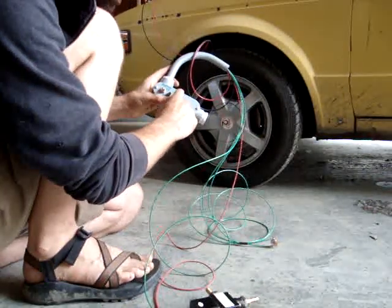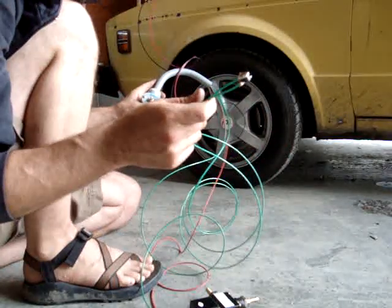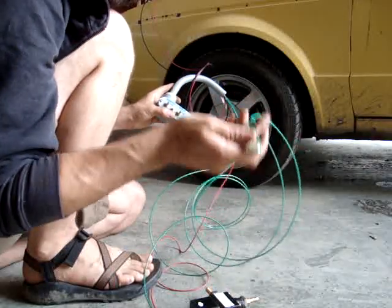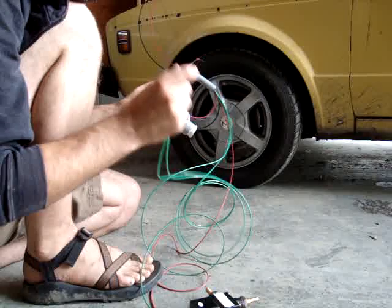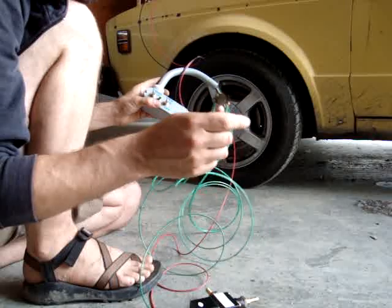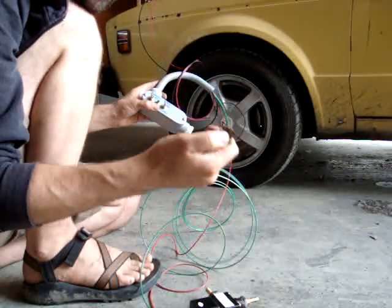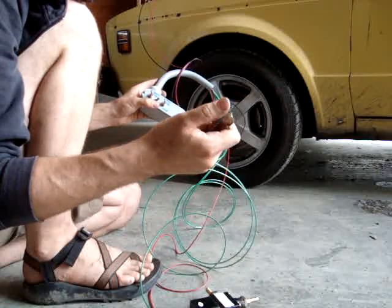So in the veg mode, basically where you have written 'veg', that's basically engaging your temperature switch, which makes it so that it'll only switch once it reaches the right temperature. And you can select the different temperatures. This is a 110 degree Fahrenheit switch, and it depends because you lose some heat through conduction, like through the tube. I hooked this to a piece of aluminum tube that the fuel flows through, so it should be reading the temperature, but the temperature of the oil is always higher than the valve. So at 110, it should be switching at least 120, probably more like 130. I also sell 100s, which are good as well.